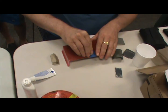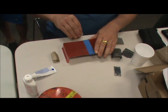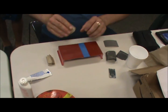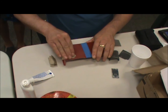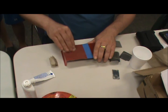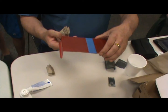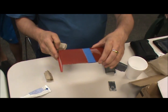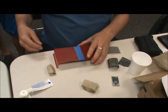I wipe the sanding residue off so I can check and see what I've got left over. This also works well to remove material that got into your paint, like dust. If you look at it, you can see that in the largest area here the orange peel's gone. I'm not going to work too much at the edges, because this is really just showing the demonstration.